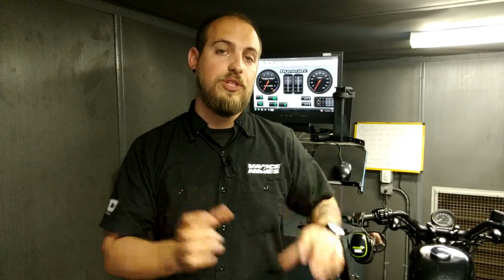Dyno has what's referred to as a step test. So what we'll do in here is we'll start it at 1500 RPM, we will step in 250 RPM increments, so 1500, 1750, 2000, 2250, etc. And we will hold each step for 5 seconds. So what that allows me to do for everything 20% TPS and below in my auto tune chart is it allows me full and total control to hit every single cell with the wideband.